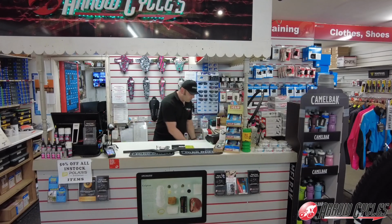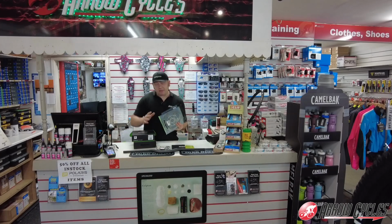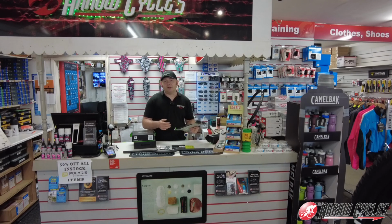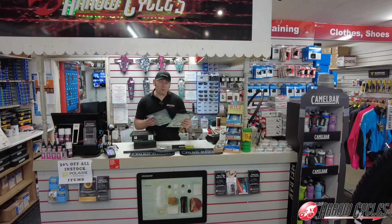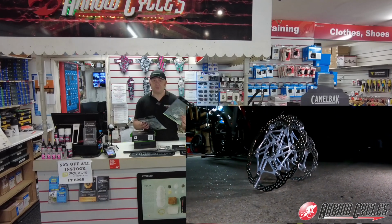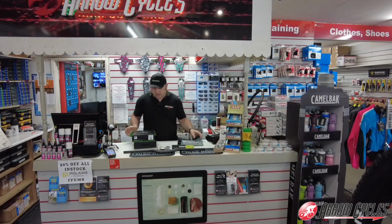Then moving on to one of the more fun parts, and that will be the brakes. Again, because this is an e-bike, we are going to go on big power. We've got large tyres on there with a lot of grip. I'm not the lightest of riders. The bike, as we said before, is about 18 kgs, so we're going to want a lot of stopping power. So I'm going to go with a 220 front floating Hope rotor with a 200 rear floating rotor, and pairing